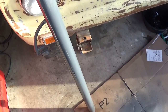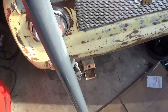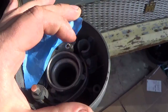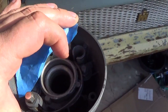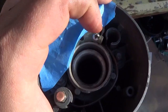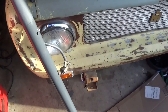I've been slaving away painting this steering column and was able to salvage the bearings off that eBay steering column — took them apart, cleaned them, re-greased them, oiled the felt pad, and stuck them back in. Now I've got two basically brand-new bearings on the upper and lower portions of the steering column.